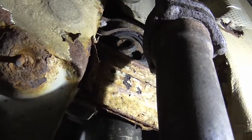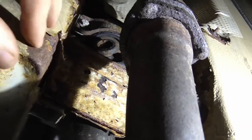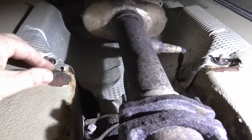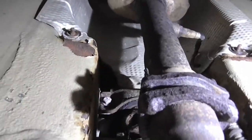What Mercedes did when they realized there was a problem with these cars is they had them in the dealerships and covered them in this white sort of mastic material to try and keep the water out. But basically all they did was trap the water in — they'd have been better off just treating the rust, because they ended up trapping moisture against the already poor quality steel, which caused it to rust even more.